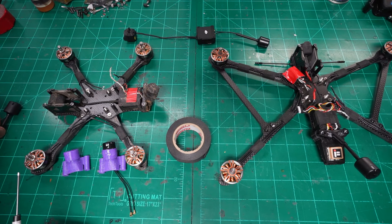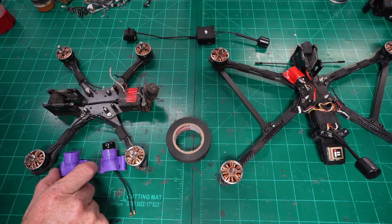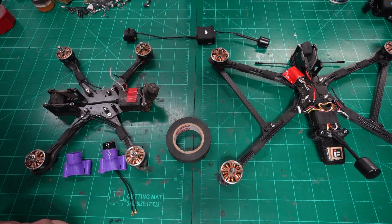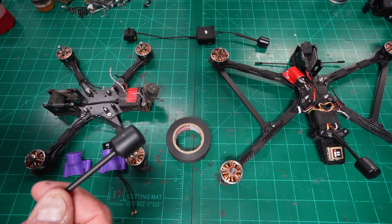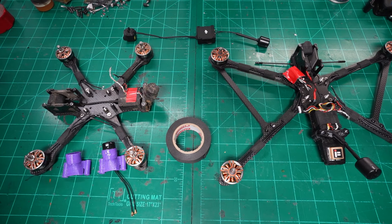The reason I'm doing this video is because I was asked to show how I set up my O3 in the Apex, and also how I make it super durable in the back of the frame so you don't damage or lose as many antennas. Because if you're running this unprotected, you're probably going to lose a lot more than a half dozen over a 500-pack period of time.